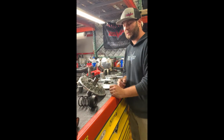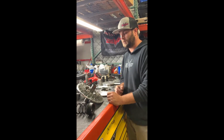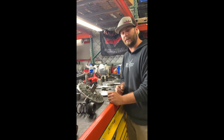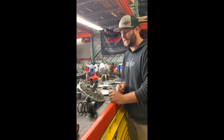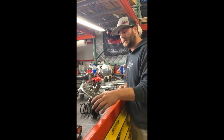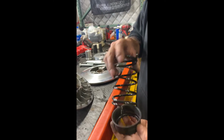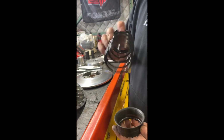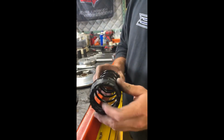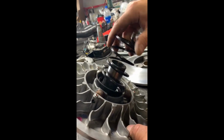Hey guys, we just did a video on the separation of your secondary. Now we're going to go over a quick little instructional video on how to reassemble. Like I said at the end of the other one, this one's a little bit tricky just because everything has to be clocked. So first thing you're going to do is you're going to take your new spring with the cup. Make sure that the stud of the spring goes into the hole of the cup, and then both of them will go into the only hole on the secondary itself.